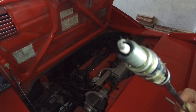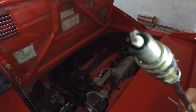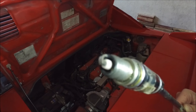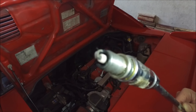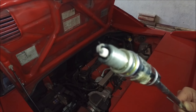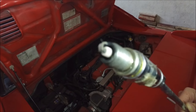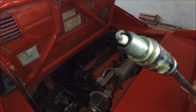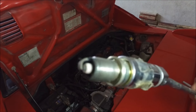If the ends are very black or if there are a lot of deposits, something is definitely not right. In the description of this video there's a link to a big chart showing images of spark plugs in different conditions and what they mean for your engine. Since the spark plugs look good, I'm going to put this one back in and we're going to keep troubleshooting.